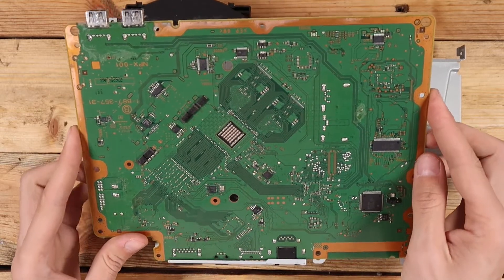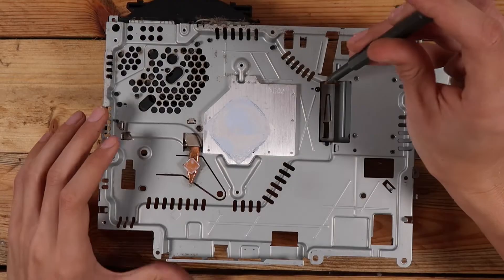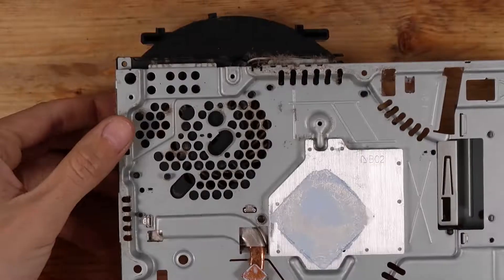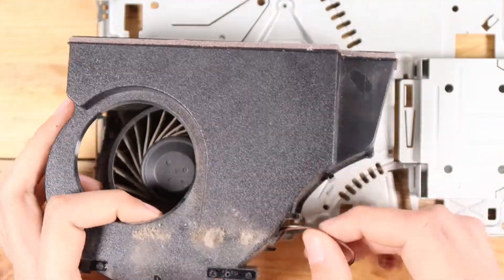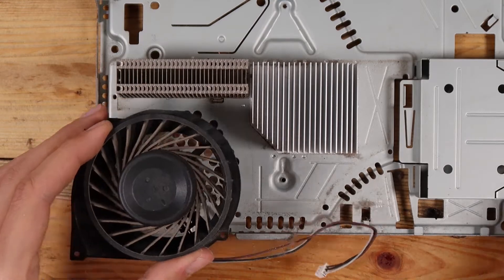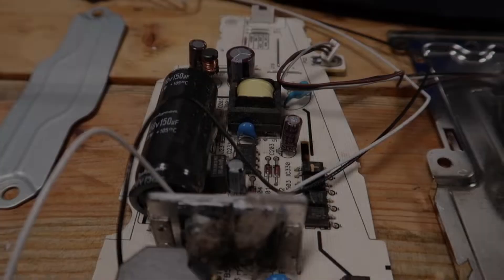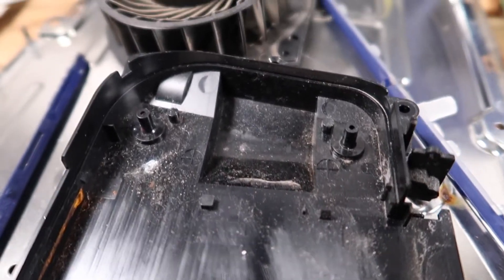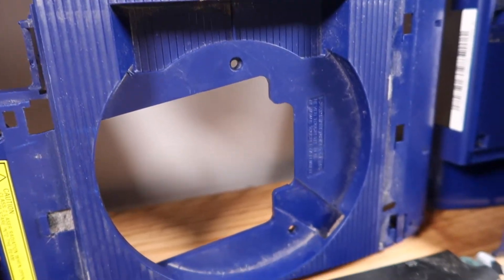Now we remove the four outer screws and the two for the heatsink. The first shield should lift up easily; however the board may be glued to the second shield due to the thermal paste — if that's the case, only lightly pry up on the board and just take your time. Then there are three screws holding down the fan shroud and then that all just comes apart. Looks like this one has been sucking up dust non-stop for the last 10 years — either way, it's bath time for this bad boy.